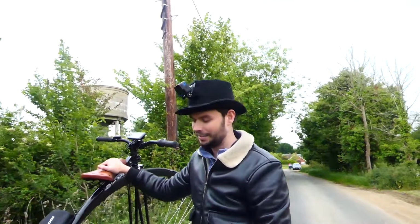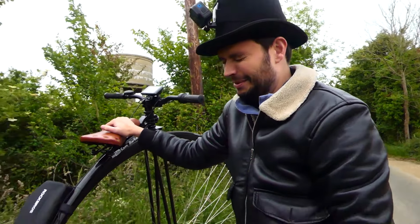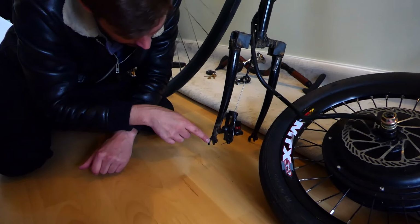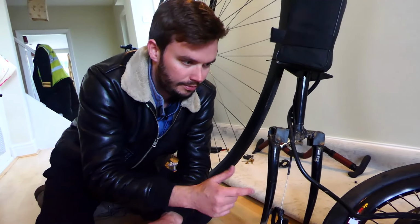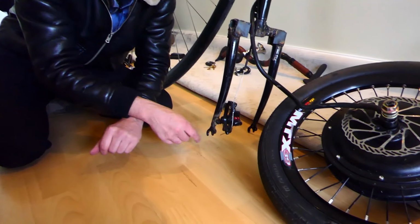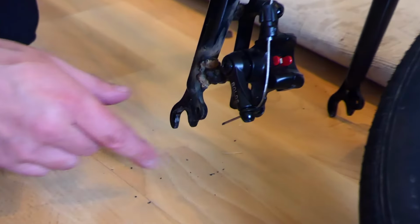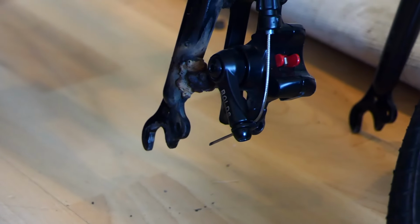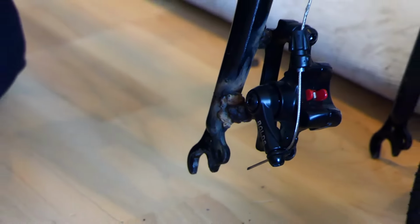I've had an incident. I forgot to do the bolts up. Oh dear. It's these bits here. You can see, normally you have the torque arms usually on e-bike motors, so you don't flex within the sort of mounts. I thought as I'm not really going to be going silly speeds, it'd be okay. I was wrong. It spread them apart, yeah.